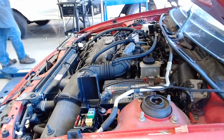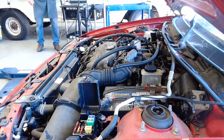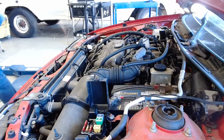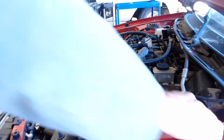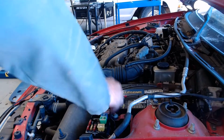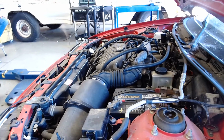So this meter, I just showed you a function of this meter that's super helpful for professional technicians. Do you have any doubt in your mind that that pump's running? No, no doubt in my mind at all. That pump is running. From experience, I happen to know that 3 to 4 amps is a normal current draw for a pump.